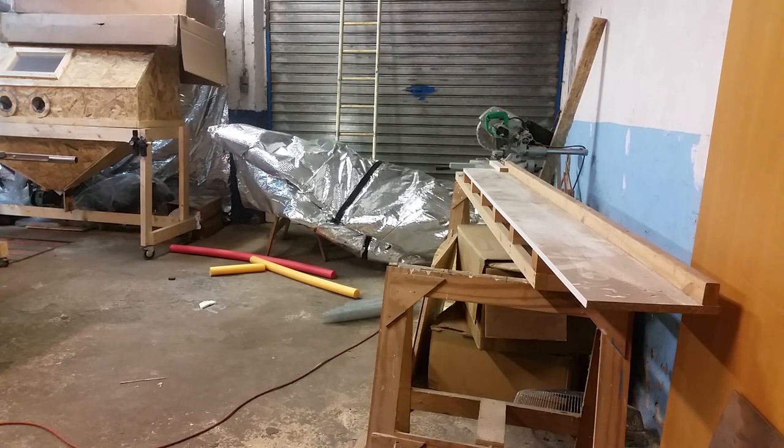Last week we finished up the air extractor, which is great if you have to get those fumes out, the overspray and stuff. But if you don't have clean air coming in, you can blow dust all over your new paint job. That's a bad thing. So what I'm going to do today is build a simple box that'll hold a filter, and then the tarp will go around it to kind of seal it in so the air is being sucked through that, and then out the extractor. You'll see more what I mean when I set the tarps up. So, that's the plan.